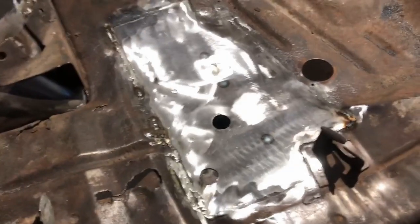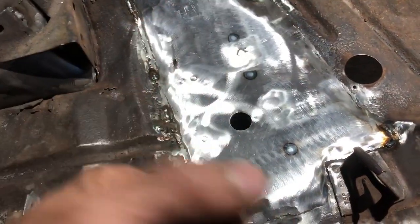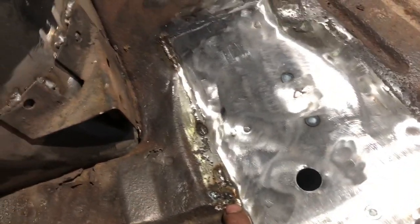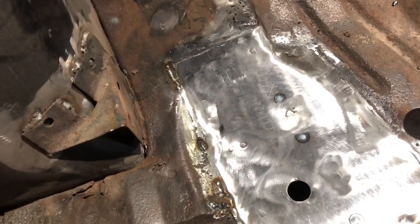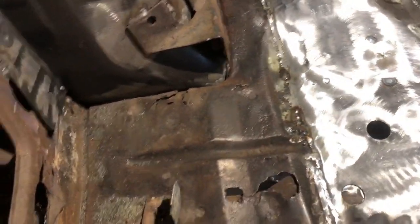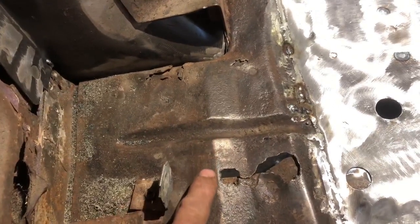In the last segment we put in this pan and I'm happy with the result. I had a light underneath and I could see pinholes shining through. Any pinhole is going to seep moisture through — I'm planning on doing an undercoat, a rock guard or something along those lines, as a thick membrane to fill some of those holes. But I really don't want moisture wicking through, so I want to patch this spot right here.